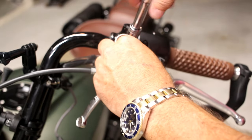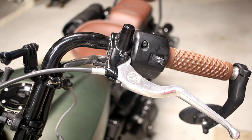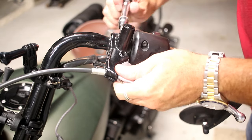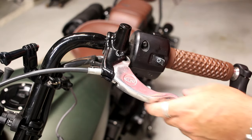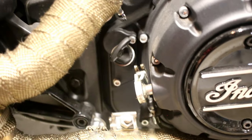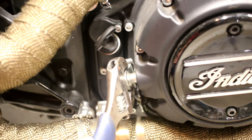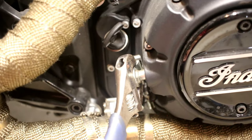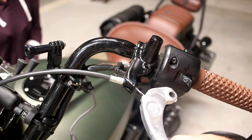Where this one's a little bit different is that clutch cable. We need to correct that and loosen it a little bit to get some room. I'm going to go over to the other side where the clutch cable is and give it some slack. I've got an adjustable wrench — I'm going to give this a little bit of a turn to get some slack on the clutch cable, and then I'll have an assistant hold it while I replace the clutch lever up there, then we'll let it go.